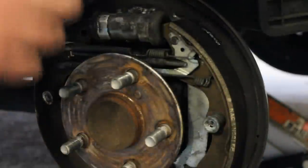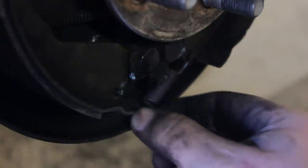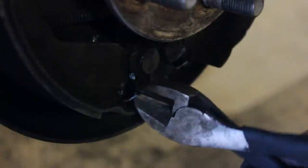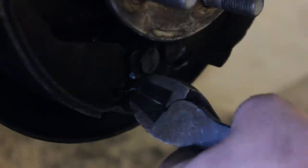Now what we're going to do is take our spring and hook him on right there. Remember the whole spring thing needs to go behind that metal piece right there. I'm going to grab him just like that and pull and set him in there like that. And that's everything all the way back together. Let's zoom out — everything is back together. Now the only thing we have left to do really is adjust the shoes to where the rear brakes will be tight for your rear wheels.